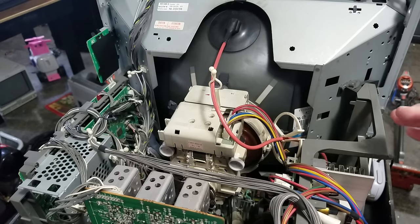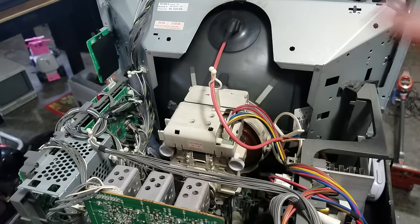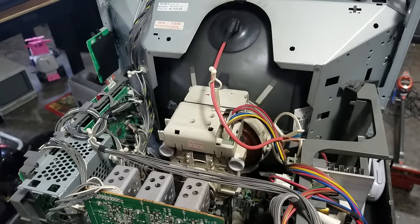After 15 years, an enormous amount of dust can build up inside these units. That dust buildup can start to overheat your components, cause extra insulation and heat beyond what was intended, and cause damage to the PVM — damage that is largely preventable. If you need help cleaning inside a PVM, I have many videos on that, including one on how to discharge a PVM so you don't have to worry about electrical shock. Use compressed air to knock off as much dust as possible.